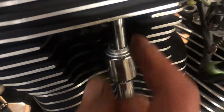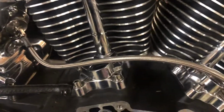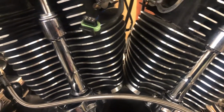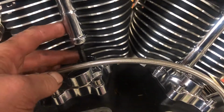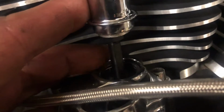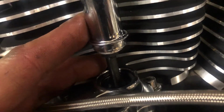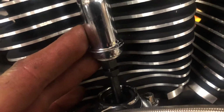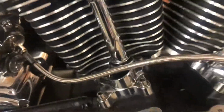So once you get them so they're just free to turn, you screw them out another 4 turns. That collapses the hydraulic follower to the right tension. So I just put a blob of paint, usually on one of the flats. These are little square sections at the bottom. I just count the flat white bit come round 4 times. Once it's round 4 times, lock off a lock nut. That's it sorted. So I'll do one and we'll come back to that.